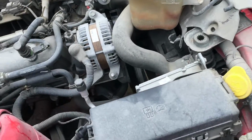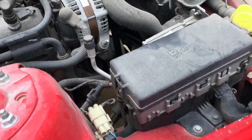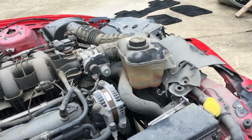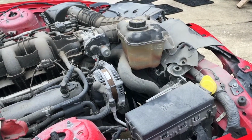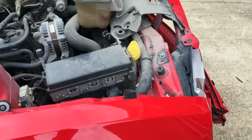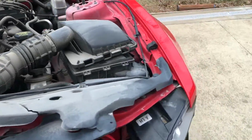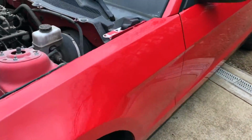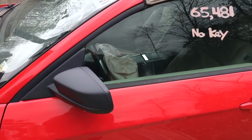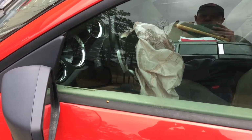I hear a squeaking noise. I think there might be something rubbing in there, like the fan maybe trying to kick on and squeaking or something. But we just have to start tearing all this stuff out and see what's going on underneath all the plastic and go from there. But I really do need to get in there and get that SRS module out because I want to send that off, as that takes a week or so by the time it gets sent to them, fixed, and then sent back. And I have an airbag on the way, so I want to get that airbag out too.